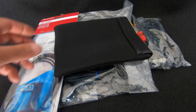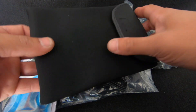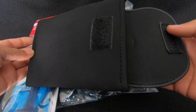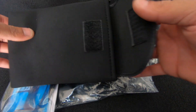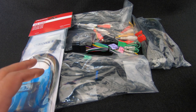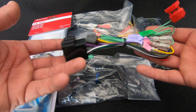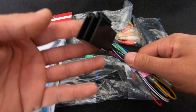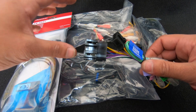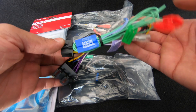Let's start with what you get in the box. One of the first things we'll look at is this little sleeve. The unit has a detachable face, so you can detach the face, put it in the sleeve and pop that away in the glove box — it's a pretty old school thing but Pioneer is still doing it. Here we have the power harness. It has ISO plugs on the back, so if you buy the steering wheel control module for one end you can literally just plug that in without having to buy the Pioneer side as well, which is pretty good.